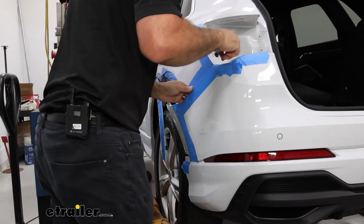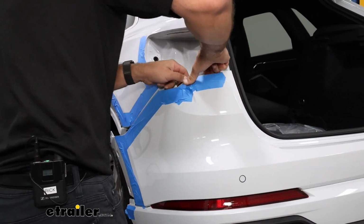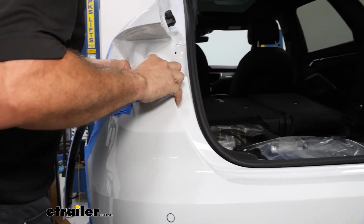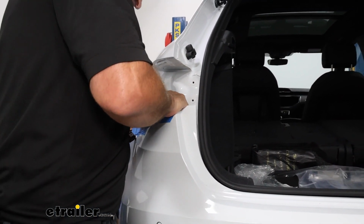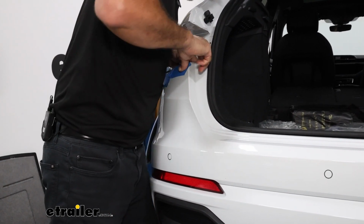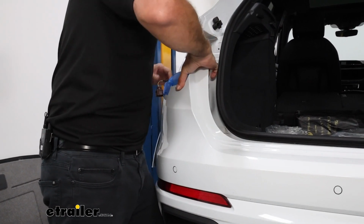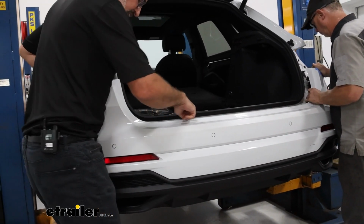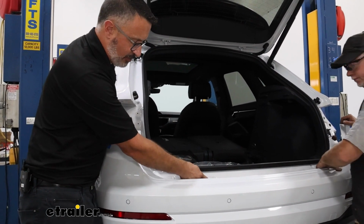Up here, at the tail light housing, you're going to have some clips. And we kind of need this to loosen up. So we're still going on an outward pressure. Okay. Now you're going to have all of these studs where we removed the 10mm nuts earlier have to come out, and that's what you heard, that noise. They were coming out of these access holes.